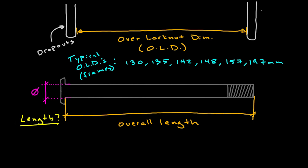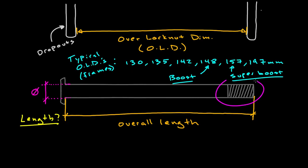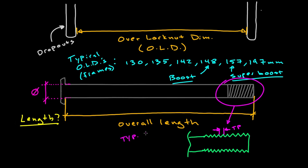And even 197 on some fat bikes. Just to make sure it's a little more complicated than it needs to be, the 148mm dimension is also referred to as boost spacing, and the 157mm dimension is appropriately called super boost. The fork also has a variety of different OLD standards, but I won't get into those. On top of all this, the thread pitch across different frames and forks aren't quite standard either. The thread pitch is measured from the tip of one thread to the next in a cross section of the axle, in millimeters. Fortunately, there are only three different thread pitches commonly used in the industry. With so many different combinations of parameters, it can make your head spin when trying to find replacement axles for your bikes.